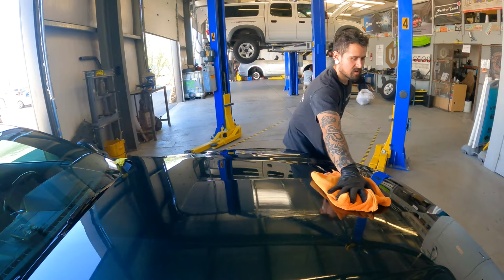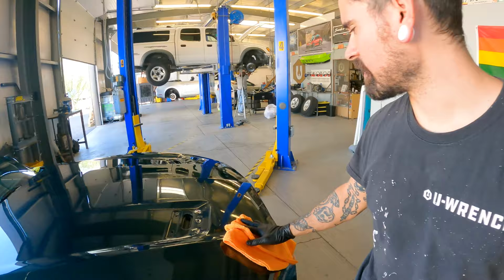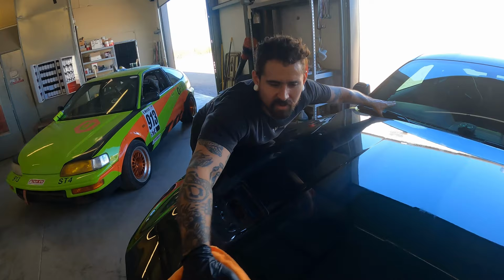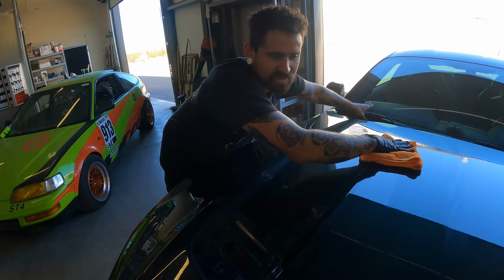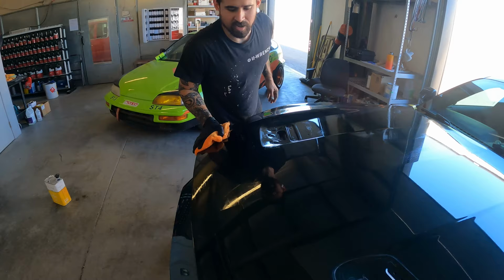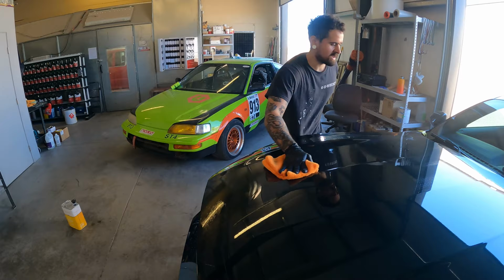But it's not so hardcore to the point where it's gonna melt the paint off the panel. It's just the extra step of reassurance, because the last thing I want to do is to try to paint over ceramic coat or some bullshit and just have it start fisheyeing everywhere, reacting, and no one likes dealing with that. So I already wiped it down with two different types of wax and grease remover, and now we also wiped it down with reducer